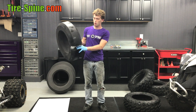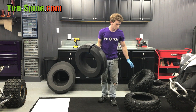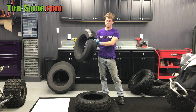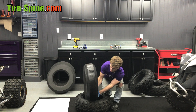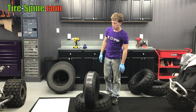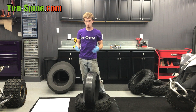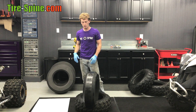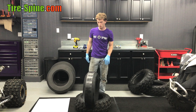Make sure that you also lube the seam here. What you want to do is lay your tire on the ground like so, take where the product is cut or slid, and feed it into the tire carcass. Once it's in there, fit it bottom down on the tire. The concept is the same as what we do with the Sport ATV — a corkscrew type shape. You're not going to feed it in like a corkscrew, but it's the concept of what you're working for.